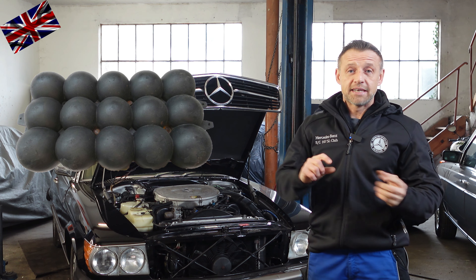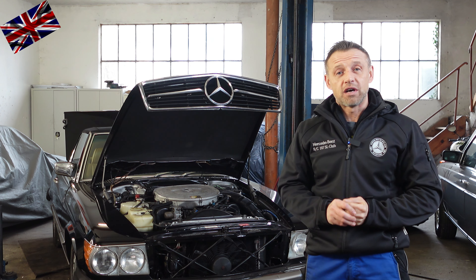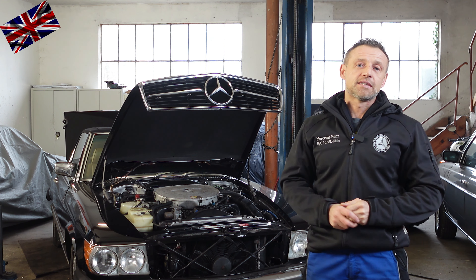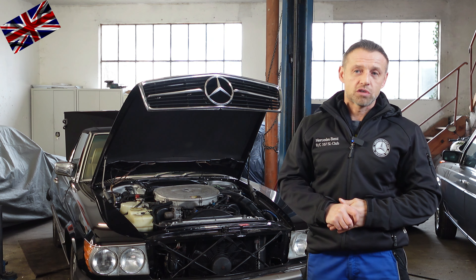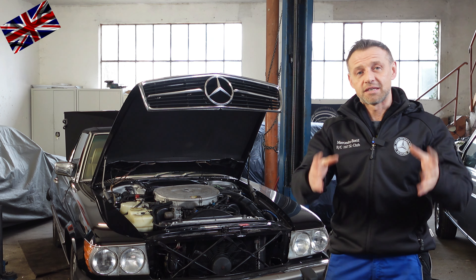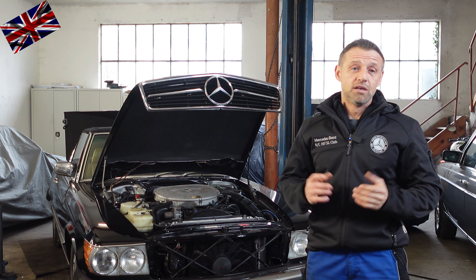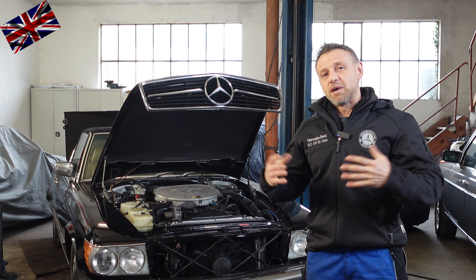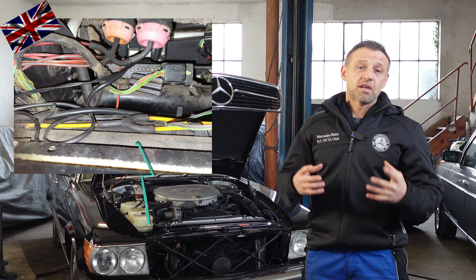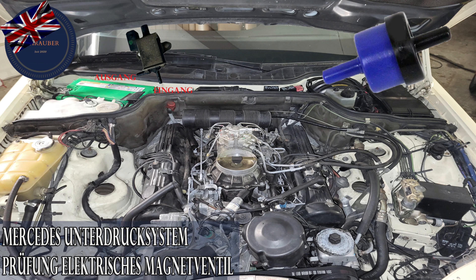Another culprit could be cracks or air intrusion in the reservoir that looks like spheres stuck together — mostly 3x5, therefore 15 spheres in total. This combination is hidden behind the wheel arch, front right hand side. This reservoir is needed to have pressure left for opening and closing the doors some 10 times or so without firing up the car, thereby activating the vacuum pump in the trunk. If there are cracks on the surface of the spheres or at the entry or exit of vacuum lines, the system will not work. Over the years the connections lose their elastic properties and crack, making them no longer airtight.